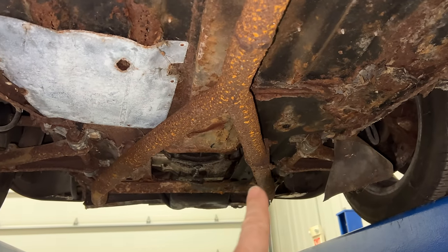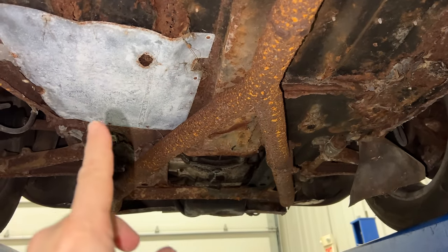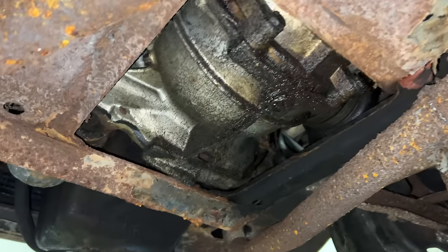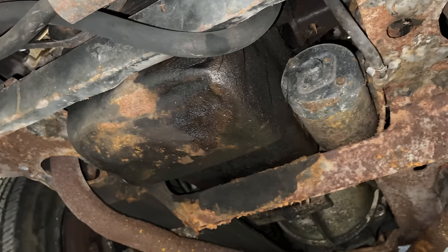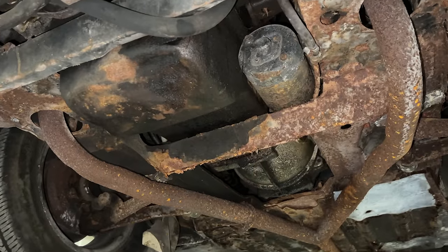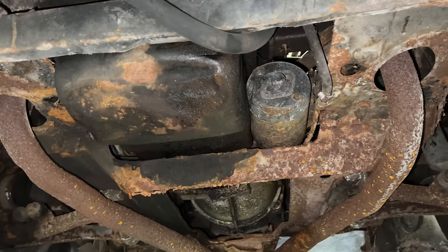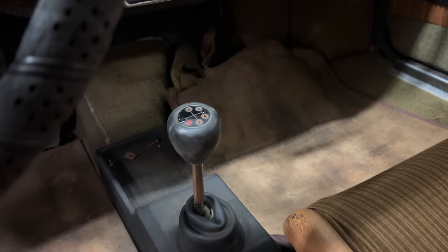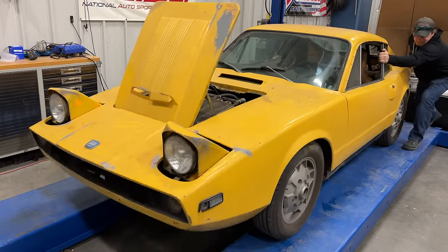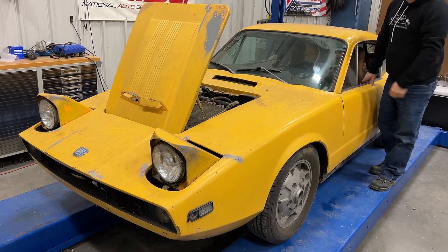We're underneath the car now. This is actually the exhaust — it comes from the two cylinders on each side and collects right here. Looks like there's a patch in the floor right here. There's the transmission, and we can barely see the engine up here. We're not really going to get to anything from below. It looks like dropping the oil pan would be an engine-out situation. Besides pulling the starter and changing fluids, there's really nothing we can do down here. I tried rocking the car to turn the engine over, but I'm just getting the front tires spinning — so the engine must be locked up.